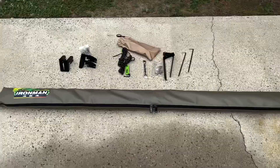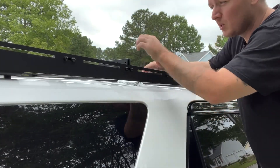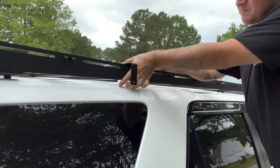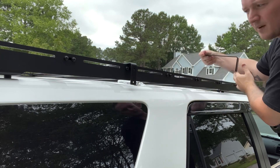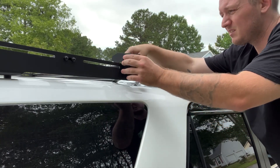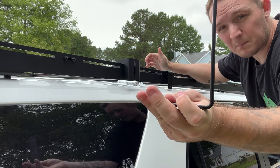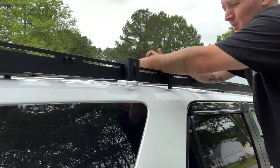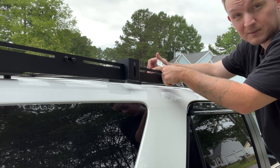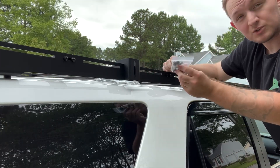I'm not going to open it up right now. I'm going to go ahead and mount the mounts, then open up the case. Now that we're on the roof, I'll show you — the ones that actually came included with the kit sit like that, and then you have your second one way down there. With the low profile kit, your awning sits around the mounting bar like that. It looks more pleasing to the eye, it's more heavy duty. These are really thick metal, but I just wanted the added security to make it more difficult if somebody wanted to steal them. The bolts that came with the awning only work with the awning kit they gave you — so keep that in mind. The new kit comes with its own hardware, so make sure you use the right hardware with the right kit.